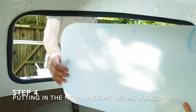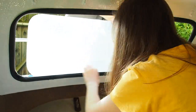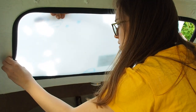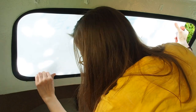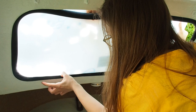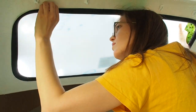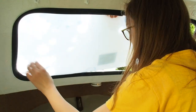Setting the actual windowpane into the hole of the boat is possibly the most time-consuming and maybe even frustrating step in this whole procedure. But don't lose hope — here are a couple of tips that can make it a little easier. First of all, I cannot stress enough how important it is to work as a team. I enlisted the help of my dad, and without him I don't think I could have done it. In the beginning, just make sure that you center the window as best as you can. If you notice that you have to move it a little to one side once you've already started the fitting process, it gets harder and harder.